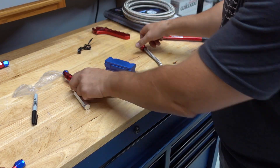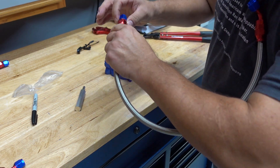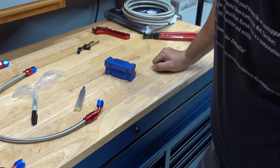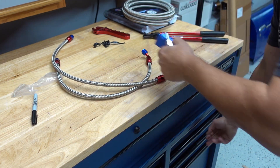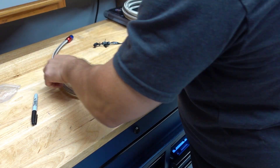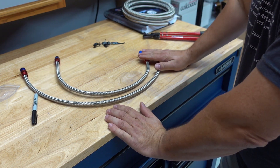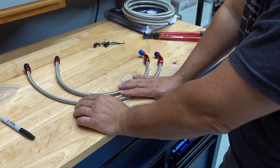Alright, well that's kind of the end of it - that second hose is finished. I kind of scratched up my aluminum on this side, but these are on pretty tight. Only time will tell if they leak or not when we actually get fuel flowing through them - that's kind of the only real way to test it. These are high-pressure PTFE stainless steel braided hoses, 6AN, and you have to get the right fittings for the PTFE. There are different types of stainless steel high-pressure fuel hoses, so make sure you match them correctly.